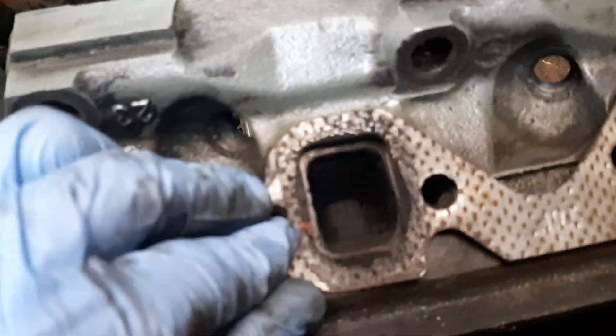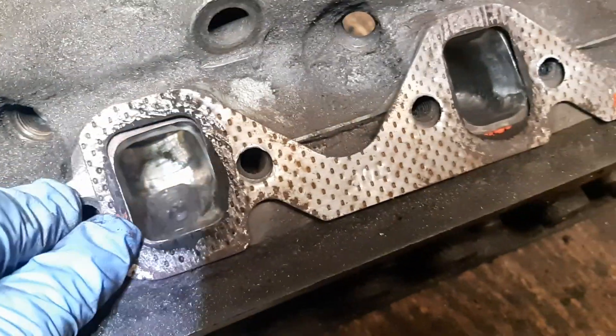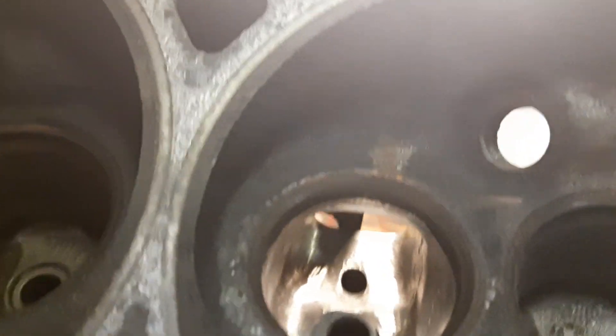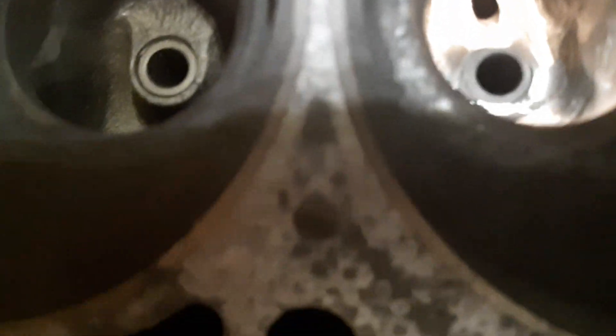Gasket matched. That's how the gasket used to fit, and that's how it fits now. Left a lot of the floor — didn't want to go into the coolant passages. The thinking is when the air comes down, you want it going towards the valve, not having to make a 90-degree turn right there. Also keeping that distance of the port the same, from floor to roof.